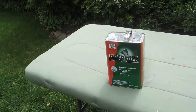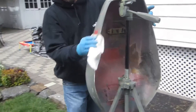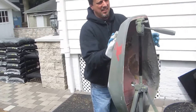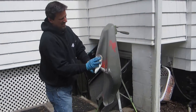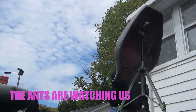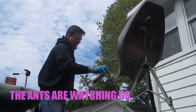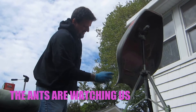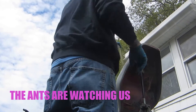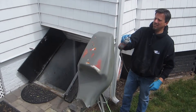Prep All — even though M600 is a thousand times better in my humble opinion, that will work. We've been using this tripod. The idea is to get all these edges nice and radiused, because that's where the paint will start to peel up. We wound up taking a zip tie and tying the seat to the tripod. Light coats now — just light coats, all you need. Tomorrow Glenn will get the official Ducati paint that doesn't match any Ducati ever made, unless you paint the whole bike — which is exactly what we're doing. We'll leave it out in the sun to cook.